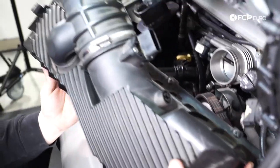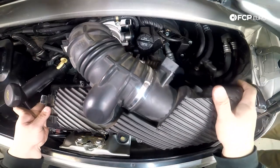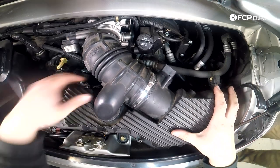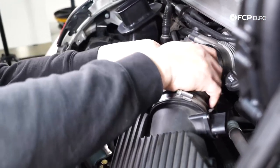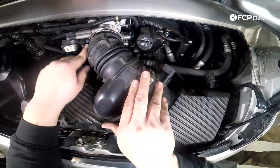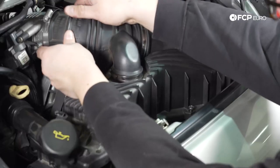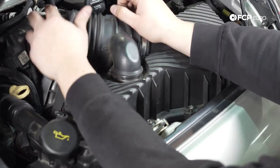It's got plenty of room to slide up and down. Fit this back over — you want to make sure your oil filler tube is out of the way. The lid itself channels itself back onto the air box, so it's really kind of hard to misalign it, although it never hurts to double check and feel all the way around before you wrap up this job. We're going to put our boot in next, back onto the throttle body. You want to make sure the boot is butted up to these ears on either side of the throttle body — once for the TPS sensor and once for the throttle linkage. Just a good reference to make sure that she's all the way on — feel all the way around. Now we have our boot butted up to the throttle body.